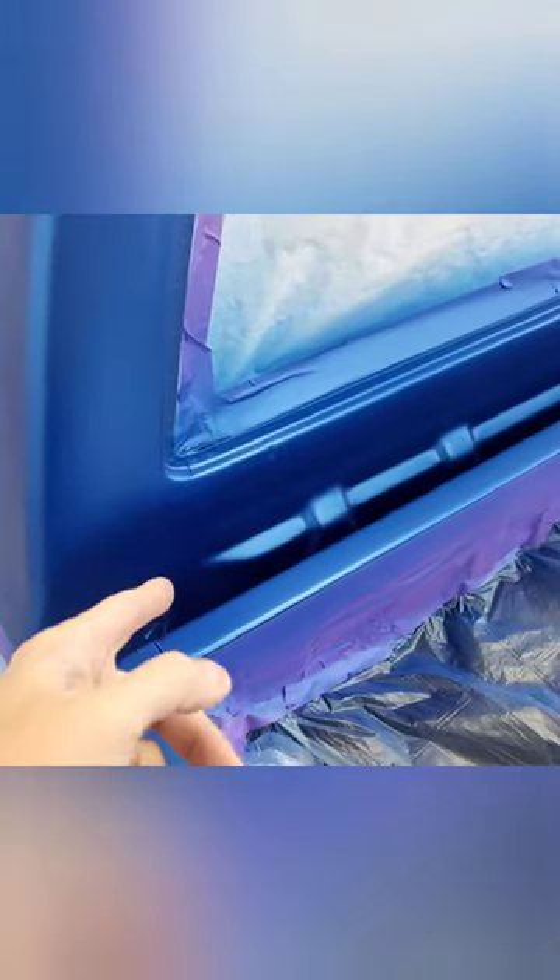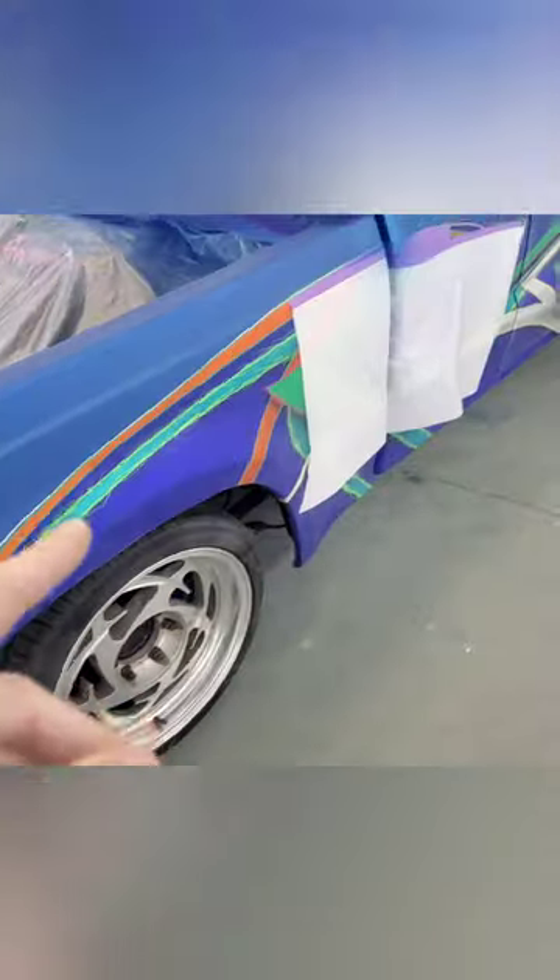We got the regular soft body blue color covered, went over all the silver stripes he wanted to cover up — just a pinstripe — and then blended it all back into the back side of the rail, and fixed the pockets that had damage inside of them on both sides. When you're doing something like this that's already pretty much cleared, you can get away with a lot because you're just sanding down the clear coat and it'll fade into the original body color really well.